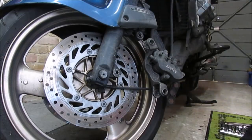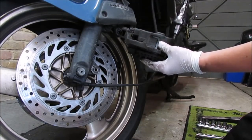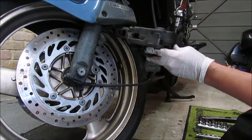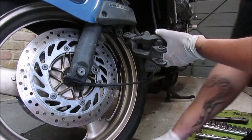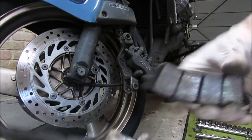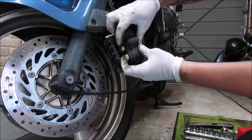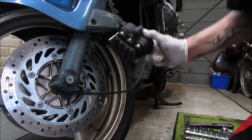I'd imagine it's going to be the same with this mounting bracket — basically seized. So let's get these pads out. I'll do exactly what I did with the back: take it all apart, clean everything up, grease everything, try and get this bracket off if I can, grease the mountings. Nice and corroded. You can see the thickness on that pad versus that one. Pumping the front brakes, these two pistons come out; pump the back brake, the middle one comes out. They weren't all coming out together — you can see quite a lot of dirt, so we're going to clean up.